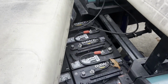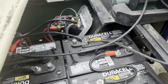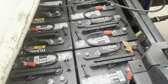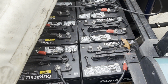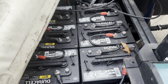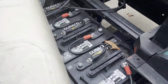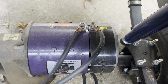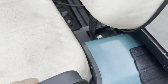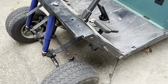But basically, guys, I'm gonna keep it at 36 volts and that 350 amp controller if it lasts. I think this is all the running gear I need. If I do any serious upgrades, I'll upgrade it to 48 volts, probably put an Alltrax programmable controller in it, and we'll probably keep that motor. But I'm pretty happy the way it is. I'm going to get it back together.